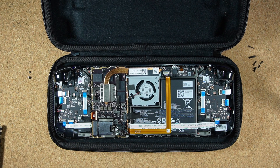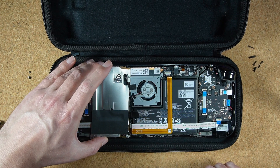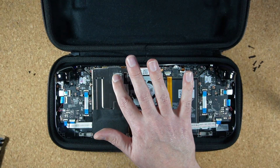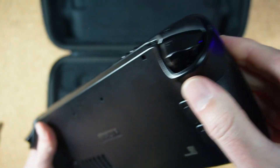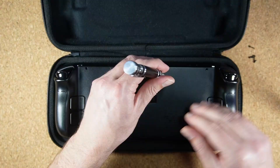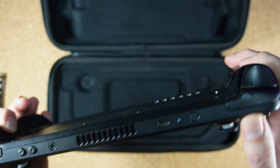Now that the drive has been swapped out, we can reconnect the battery. Then replace the metal shield by putting the three screws back into place and sticking the foil back where it belongs. Grab the back shell and click it all back together, then replace those eight screws. Well done — the hardest part is officially over.